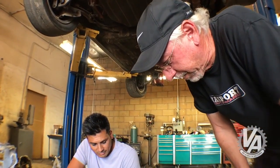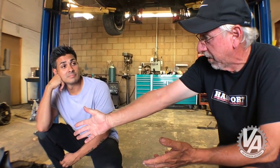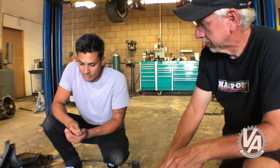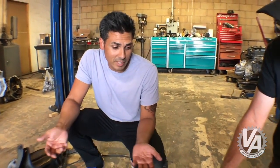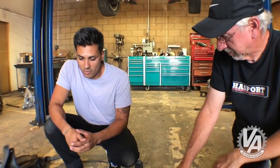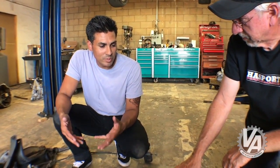A couple of people have been doing all-wheel drive conversions. Obviously, this doesn't bolt in. We found that this lower control arm is longer and taller. This subframe — there's no place to bolt it into. It's actually quite a bit farther back. We would love for this just to be a bolt-in deal, but it's not. It has been a fabricating kind of ordeal.